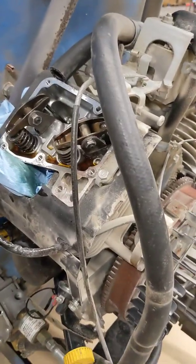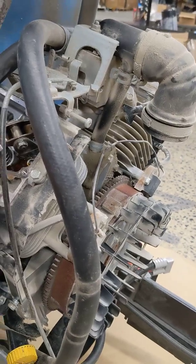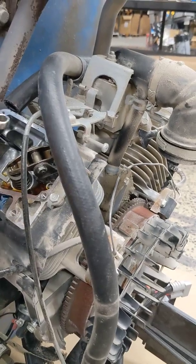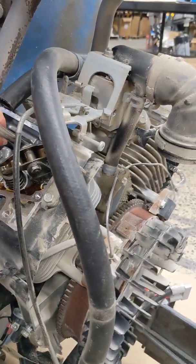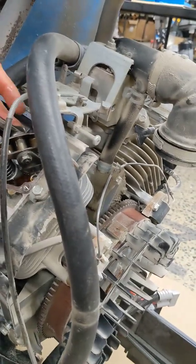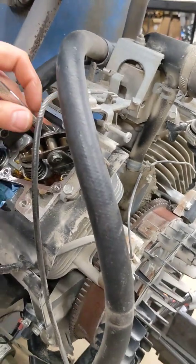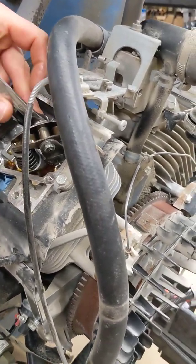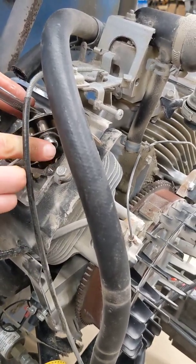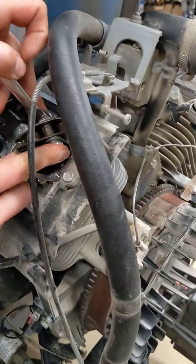You want to actually have a good quality set of wrenches for this, because if your wrenches have a little bit more wiggle room in it — these bolts are metric, so it's not SAE, it's still a 10 millimeter wrench — but if it's not positioned perfectly, I'll go and tighten down this nut and it actually will move mine. It'll strip, and it'll move the spacing.